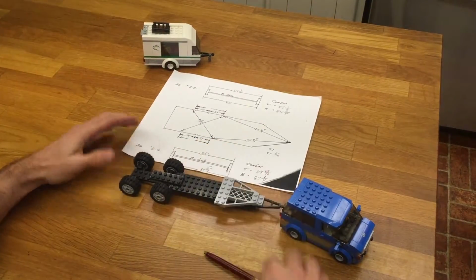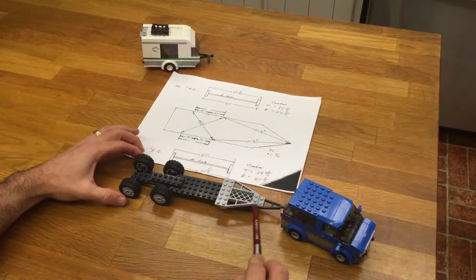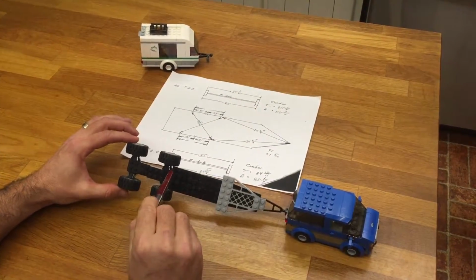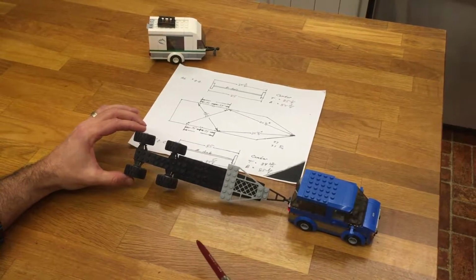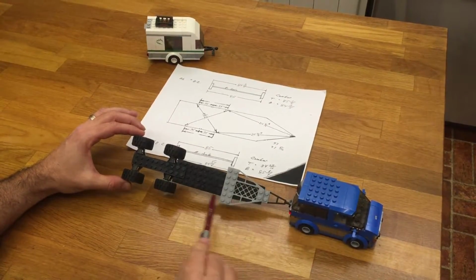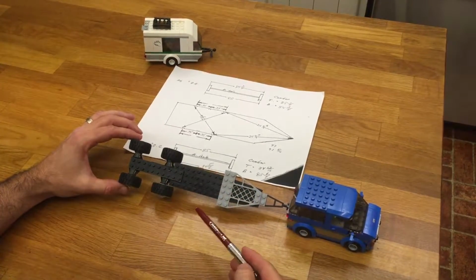Now the other issue that you see here, we measured from the front back to the front hanger. So that would be from the front center of the ball here to this front back hanger and to this back hanger. What you're looking for there is to see whether your frame is straight or if your frame is bent. Luckily for us, we've got a straight frame, so that allowed some simple replacement, not a more complex replacement.